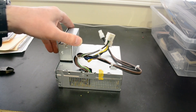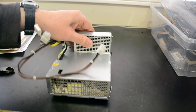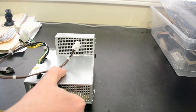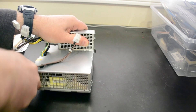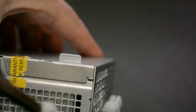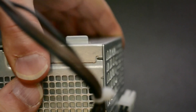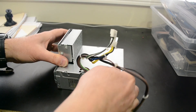Now we need to take the top plate off. It actually curves down from the top of the fan, over the body, and down the back — but it's all one piece and it's all relatively easy to take off. You might need a little screwdriver or something to help pry at it, but you shouldn't have to beat on it too hard. Once you get it started, it comes off relatively easily. The trick is this little tab here that kind of gets caught into a little notch, so you have to wrestle with that one just a little bit — that's why it's a little tricky. Once you've got it loose, the whole top should just come off.